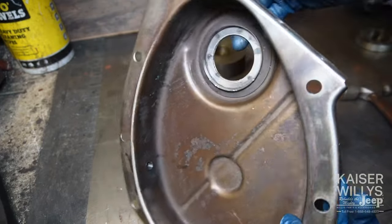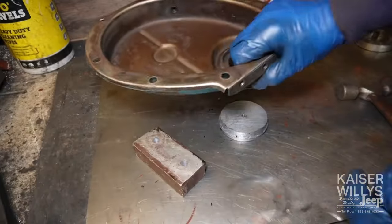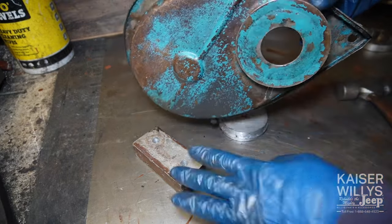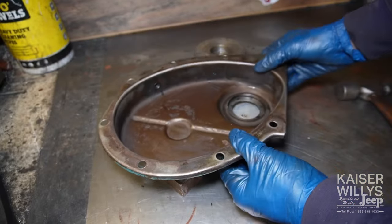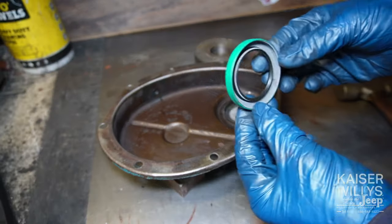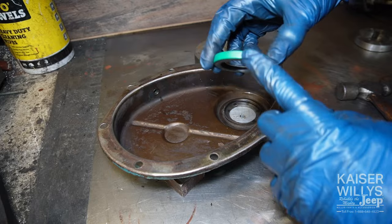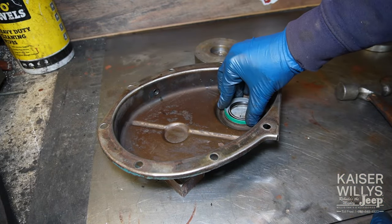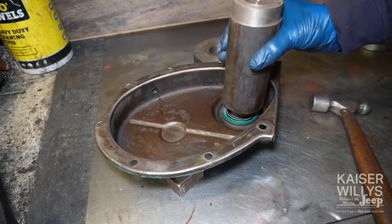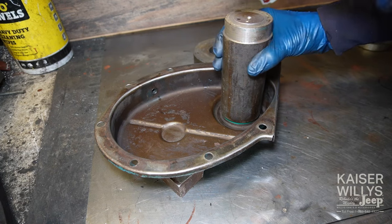Cleaned out the seal pocket and all the gasket surfaces are cleaned and wiped down. If you notice, this front cover is not flat — there's a ridge right there. So we don't want to just lay this flat on our table and drive the seal in that way. Get something small and round that fits inside where it is flat, and then another piece to support the case so it doesn't wobble. We're going to drive our seal down from the inside, which is a little bit backwards compared to a normal seal. You can see this has a spring — your spring always goes towards the oil. You don't have to put anything on the seal itself. Set it in the seal pocket as straight as possible. You want something that rides on the outer part of the seal, not the inner part. Tap it gently, make sure it's straight, and then all the way until it seats.